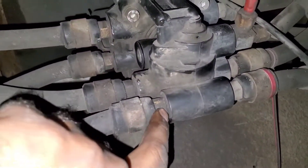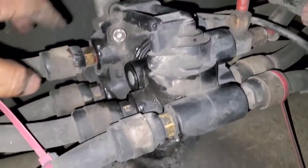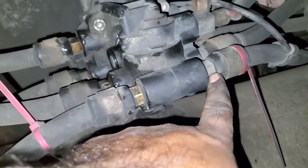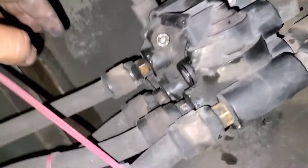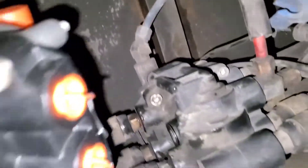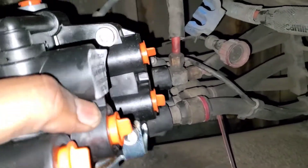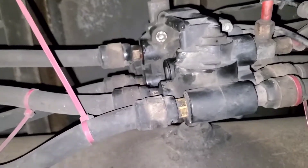As you can see, it's easy to replace this air valve. There are a few bolts connecting to it, and the airlines are connected with small bolts which you can open with an adjustable wrench. You'll need to disconnect a couple of airlines and then disconnect the valve from the tank, which is easy with an adjustable wrench — no special tools needed. Before you remove the valve, make sure the new one you bought matches the old one.